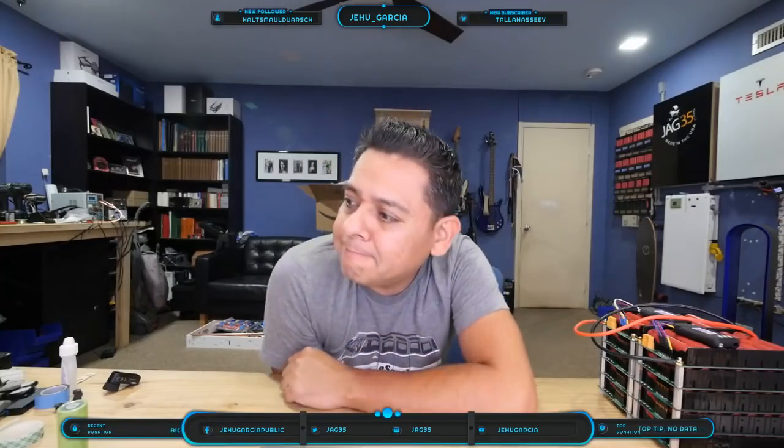Really? If you have access to the 3,400 milliamp hours, I want to buy some. I want to put 300 miles, so what is that? At least 60 kilowatt hours on my bus. That's what I want to put, and I want to build all the modules custom, so they fit everywhere where they're not visible. The floor, in the back, where the gas tank used to be. I'm going to make all those modules 100% from the ground up, so that I can pack them really well in there. But yeah, I'm looking for the best energy density that I can relatively affordably do.